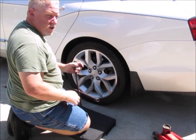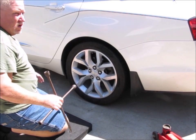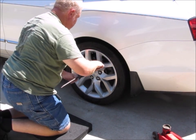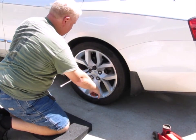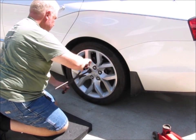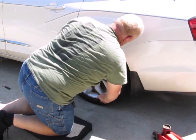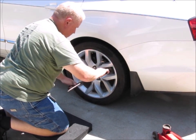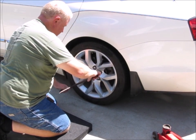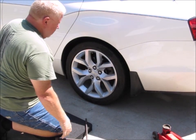Manual is going to give you torque specifications for the lug nuts. Now, I do not have a torque wrench with me right now, so I'm going to have to torque it later. But what you can do, especially if you're on the side of the road where you don't have a torque wrench, all right, tight, and remember your star pattern. That one a little bit more. See this horse fly? Alright. So, got the five of them run down.